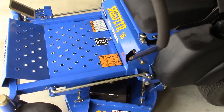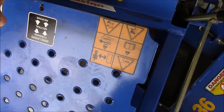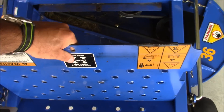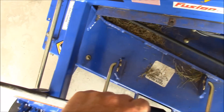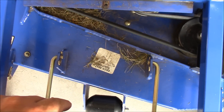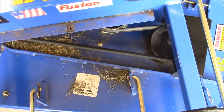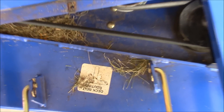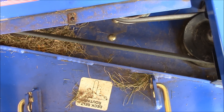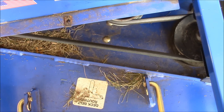This mower, being a small deck, actually has two blades that turn. We'll take a look under this flap — loosen it up, and the flap comes up just like that, giving you access to your blades and you can do some adjustments down here. It also shows you how the belt is routed. It does take a 5/8-inch V-belt, and this one's actually Kevlar, which is a really nice belt if you consider this machine residential.